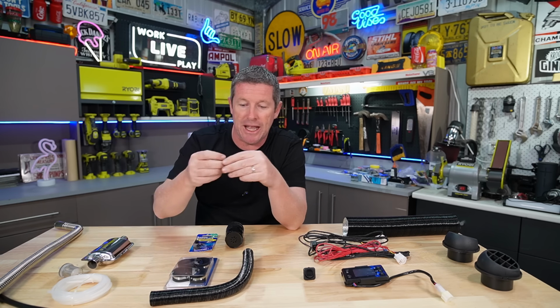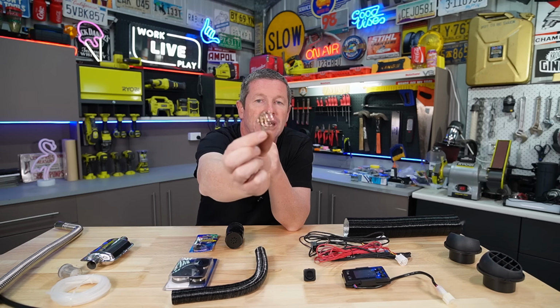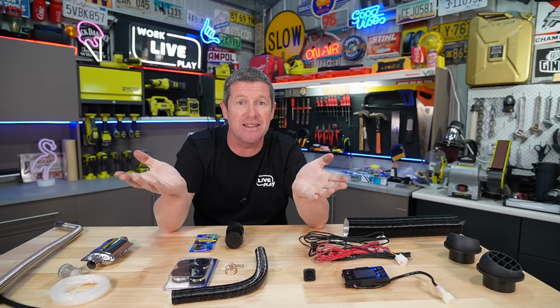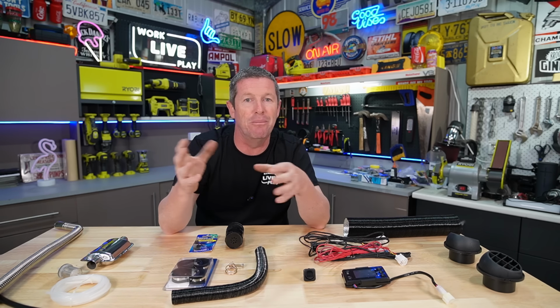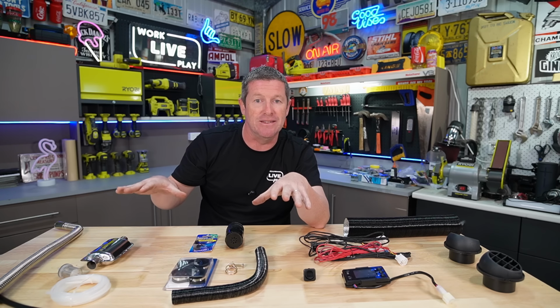The other final thing when it comes to these 25 mil pipes, so that's the intake underneath and the exhaust, is that the clamps that come with the kits are generally considered not very good. You want to get a standard stainless steel wind-in hose clamp, like what you have on a lot of your radiator hoses in a car. And the size needs to be 18 to 25 mil, I think it is. I actually got the 25 to 35 and they're a little bit too big. So I do have some, but they're the wrong size for this particular application. I just had a best guess while I was running around a few weeks ago, but I'll definitely update that and they'll be what I'll use as part of the installation.